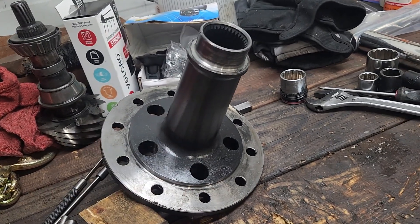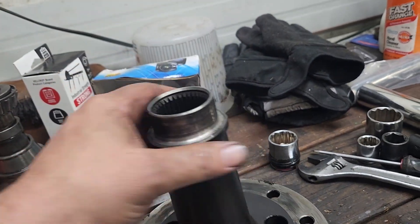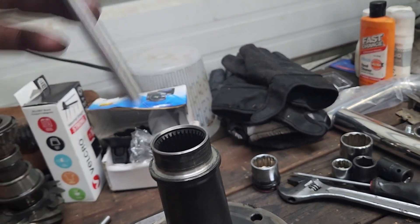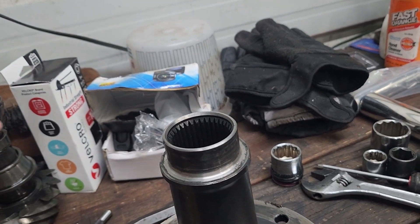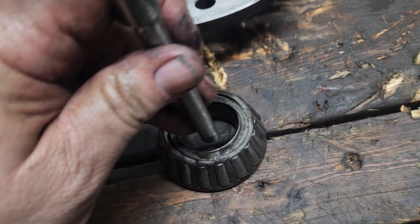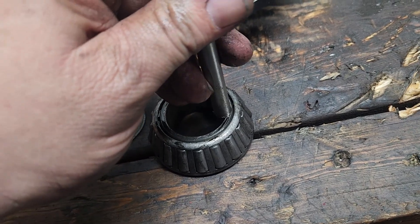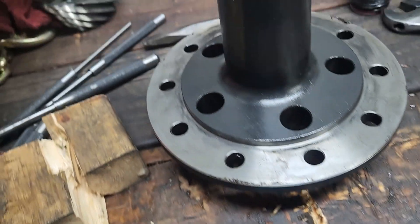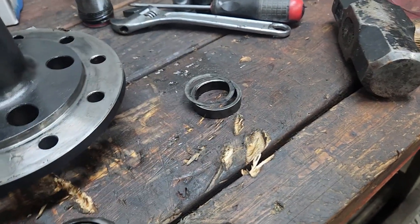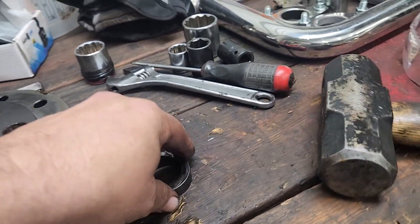So now what we'll do is put this in the freezer overnight. Then we'll put the bearings in the oven at 400 degrees for 30 minutes - it should slide right down. If not, we can put this right on the lip of the bearings and knock it down until it goes all the way down. Hey, there's a spacer. I use a solid spacer - I don't use crush sleeves. Crush sleeves are junk, especially if you're drag racing, because if it crushes more it's going to mess up your pinion bearing load. So I use these solid spacers and you just shim them out to where you've got enough pressure.